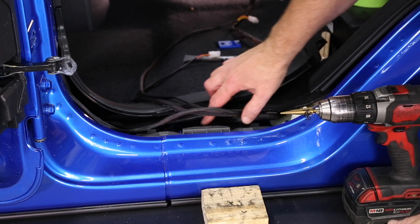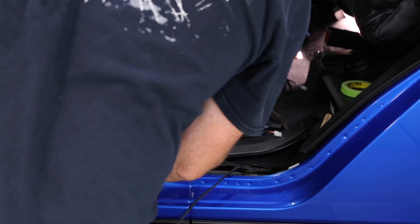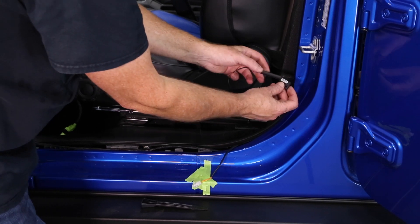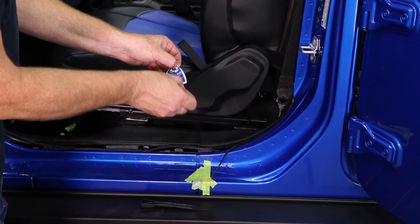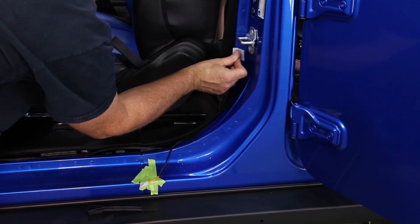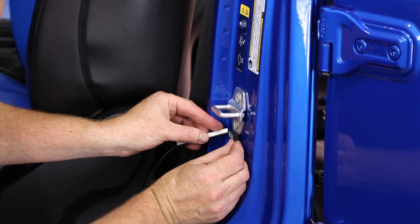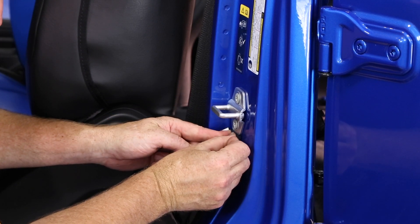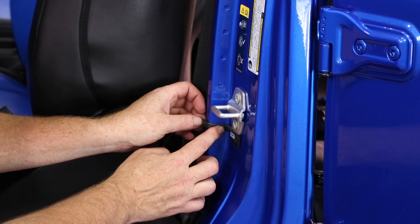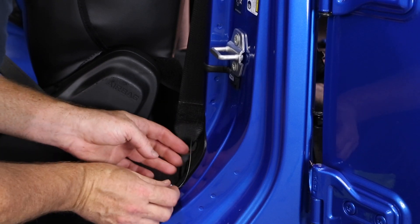Wait until all the slack is taken out of the wires before running tape back over the top. The orange-yellow wire gets fed toward the front. In the kit you'll find four door sensors that mount right underneath the door latch plate. Start with an alcohol wipe, clean right underneath the door latch plate and around the corner, then peel the sticky back and push it underneath the latch plate. Hold it for a couple seconds, peel the white backing off, go around the door flange and underneath the panel, and plug it into the front door harness, then tuck the wires out of the way.